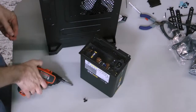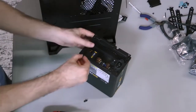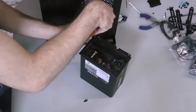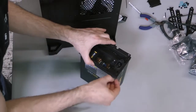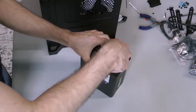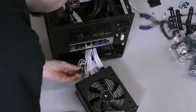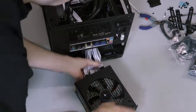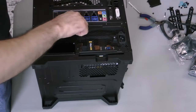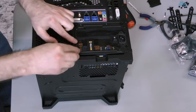To install the power supply, figure out how you want to orient it. The 250D allows you to orient the power supply's intake beneath the motherboard tray, thus pulling warm air from the bottom of the CPU through the power supply and exhausting it out of the back. Alternatively, you can orient the power supply's intake to the bottom of the case, giving it its own source of cool air. Since the RM750 is not liable to be stressed too heavily by our combination of components, I'm going to orient it with the intake facing the bottom of the motherboard tray. Attach the bracket to the power supply with four screws, but loosely so that it has some wiggle room. Pull the modular cables through the power supply bay and attach them all to the back of the power supply. If you're planning on including additional peripherals later, attach whatever additional power leads you need to now. Slide the power supply into the bay, then attach the power supply bracket to the case with two thumb screws and tighten the four screws used to affix the power supply itself to the bracket. Since we're not going to install any more drives today, reattach the drive bay plate to the back of the case and secure it with the four thumb screws.